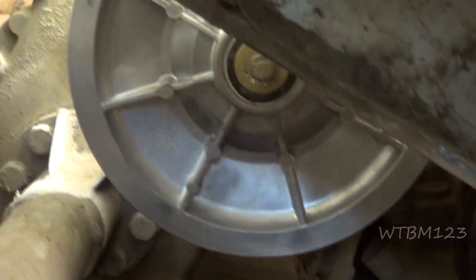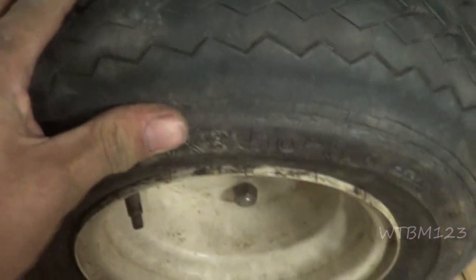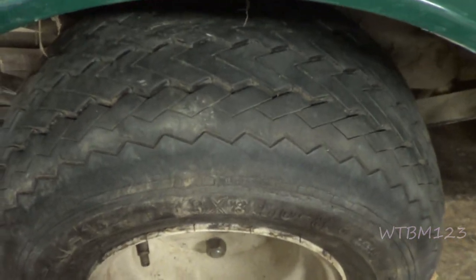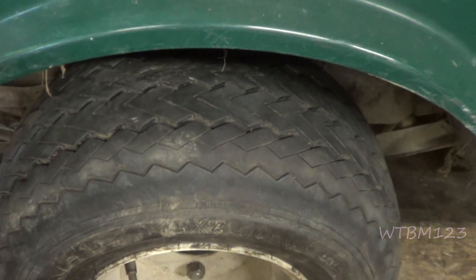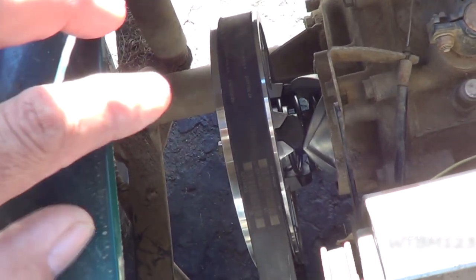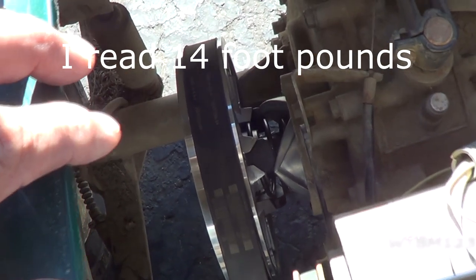The next hardest part is rolling the belt on. I'm putting the belt on there and just rolling it — it takes two hands. We got the inner fender back in and the wheel on. The other tire has a problem so we'll put another tire on it and take it for a ride later. There's the new clutch on there. You'll have to look up the torque specs — I think it was 14 to 22 foot-pounds, but I'm not 100% sure on that, so you might want to check that out.